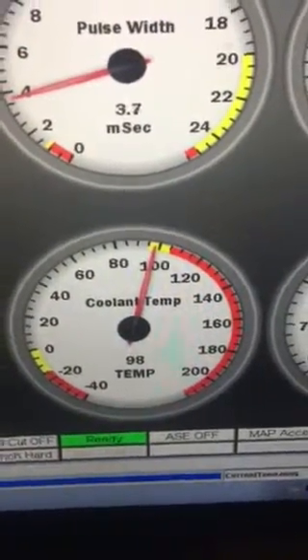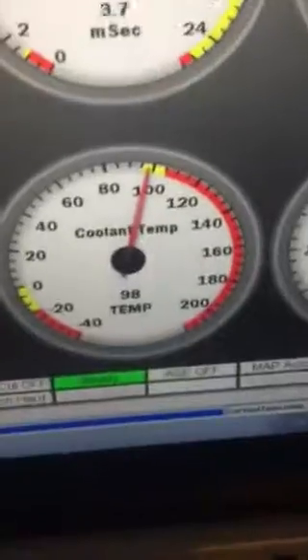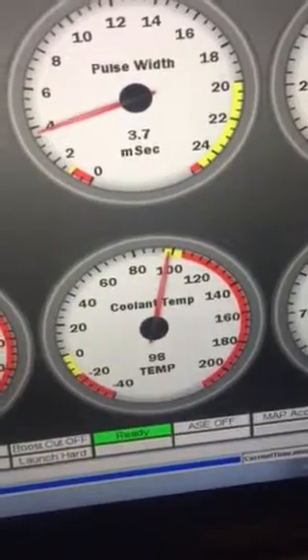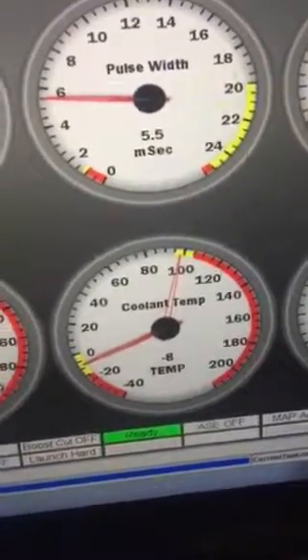Let's try something else. I'm moving the pin on the IDC40 connector to number 37. That's all I've done, and now I connect my output — I have a voltage. The voltage is present at a temperature of 98 degrees. Now I'm going to turn the temperature below 85 down to 82 degrees, and there we go — we're sitting at minus 8.